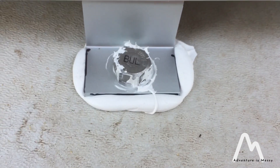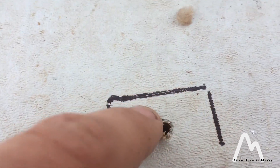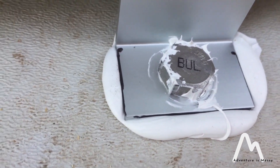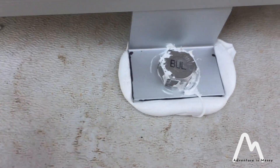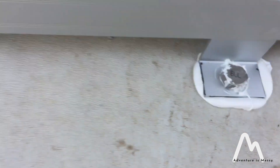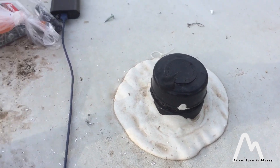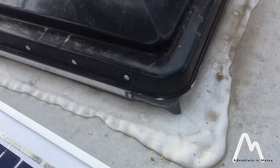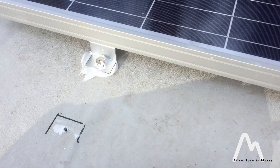So this is what it looks like. I draw the whole square out, then I take my silicone and go around the hole real good. When I actually tighten up the bolt, it squirts the silicone all up out around the side, so I get a real good — almost like a donut — under there. And when I'm all done, I'll go back and fill over that hole. If you look at most RV roofs, this is how they silicone everything. It's a pretty flat rubber roof up here, so there's not any crazy pitch to it. Anytime they use silicone, they just put it everywhere. So these whole feet are just going to wind up being covered.